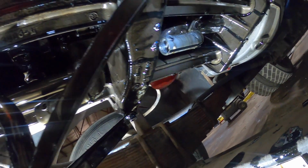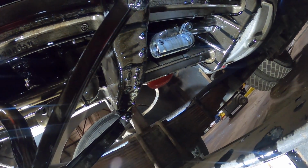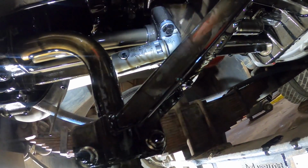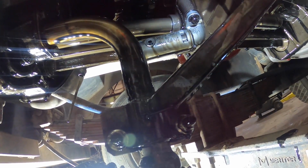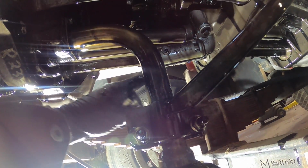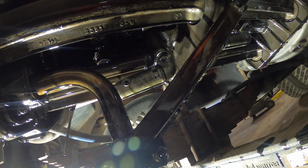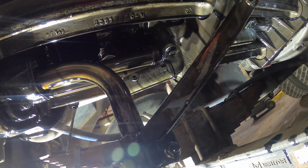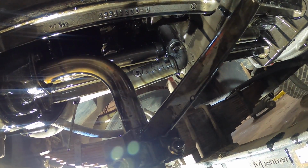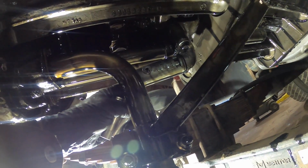There's one regulator back there that says 92 regulator, and this one here says relief pump or cooler side. So I got them on the right side. You would have known if you'd had them on the right side or the wrong side from the beginning when you started the machine, because the oil pressure wouldn't have been right. This is relief pump or cooler side.